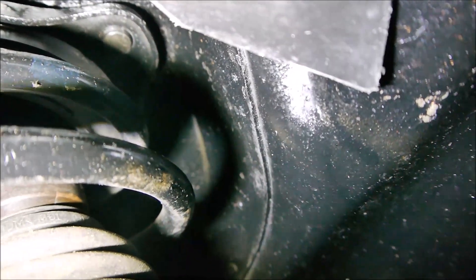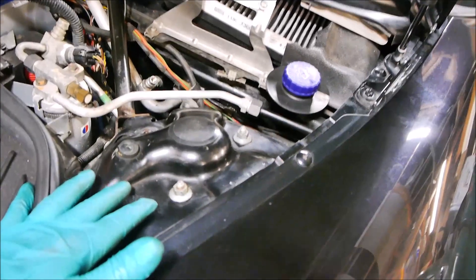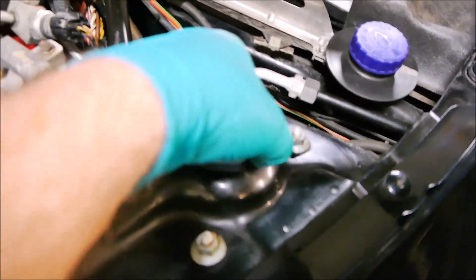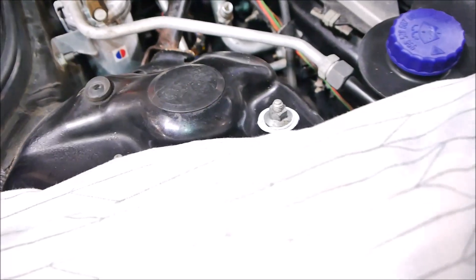These studs are actually splined, pushed in - you can see from beneath, you can just see the stud there and how it's pushed in. It's not welded in, it's on a spline. I'm going to try and knock it out in situ, but the reality is there'll probably be so much flex and bounce in it that I won't get the force needed. The other idea is to block something up underneath to the ground to take all the shock out of it and drift it out. I tried just hitting it with a brass drift but I could feel all the spring below just taking the power out of the blow.